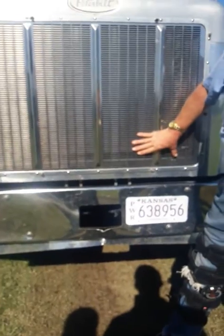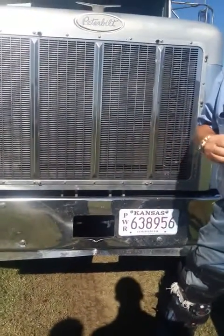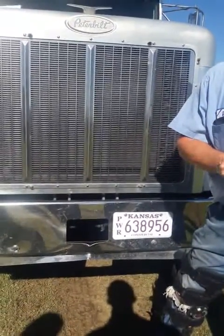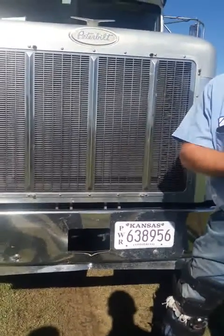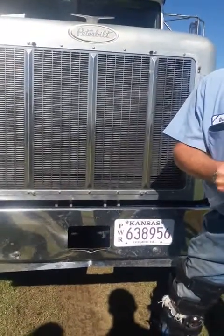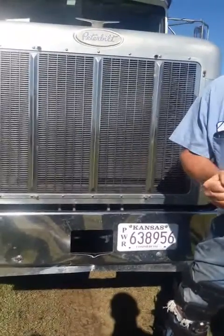That's going to be the one thing you're saying the most. If you forget, like say on the injector, if you forget what you're looking for, no visual defects covers everything. But try to remember, if something has fluid, you're checking for leaks. Air lines, you want to make sure they're not leaking. Radiator hoses, they're not leaking.